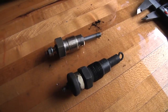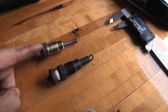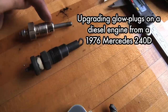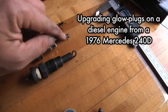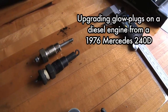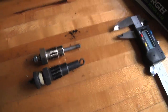We are back working on those glow plugs again. This is the old-style glow plug, this is the new-style glow plug. One thing I noticed is that the upper part is the same between the two, but the heater element on the new one is skinnier than the old one. That's the area that's supposed to get reamed out to get rid of the old carbon that's gunking it up before you replace the glow plugs.